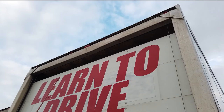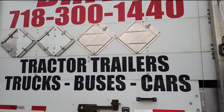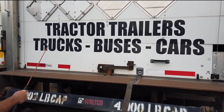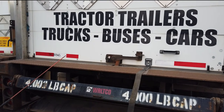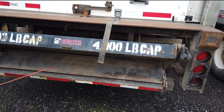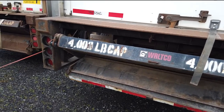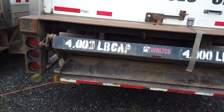Back of the trailer — clearance lights in the top: red color, no missing lens, clean, properly secured with the hardware and working properly. Back door: locked and secured with the lock latch, no missing hardware, no crack, bent, or broken. Door properly attached and secured with the hardware, no missing holes, no missing rivets, no visible holes, should open and closed properly. DOT reflector tape: visible, clean, and covering 50% of the door.